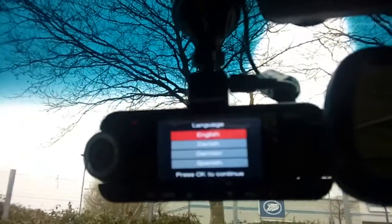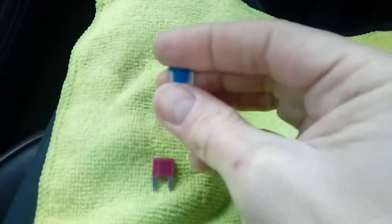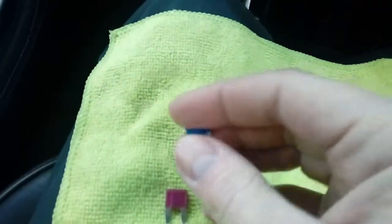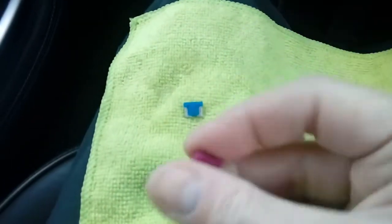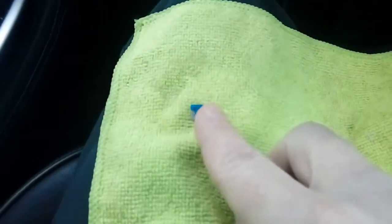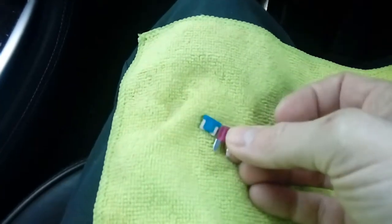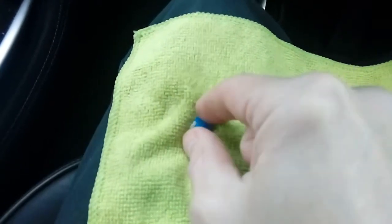Just lastly regarding the fuses: your car more than likely is fitted with this style — the stubby style of fuse. Your fuse spur will plug in no problem and sits slightly higher than the original fuse, but that's not an issue. However, you're going to need to replace the 15-amp (or 8-amp or 10-amp, whatever you've pulled out) stubby fuse with a full-size bayonet fuse. They're all colour-coded — blue ones are 15-amp, red ones are 10-amp, etc. It's exactly the same width with metal pins so it'll fit in just fine. Where you've pulled that original manufacturer fuse from, you put your fuse spur in, and then you want one of those full-size fuses to fit into the top of your fuse spur, because the stubby fuse hasn't got metal pins sticking down. Just thought I'd mention it in case it's a bit confusing — there are many variants of fuses.